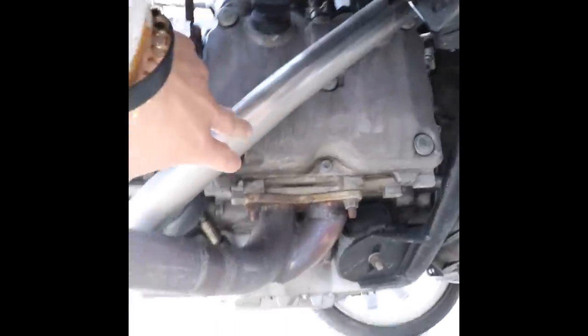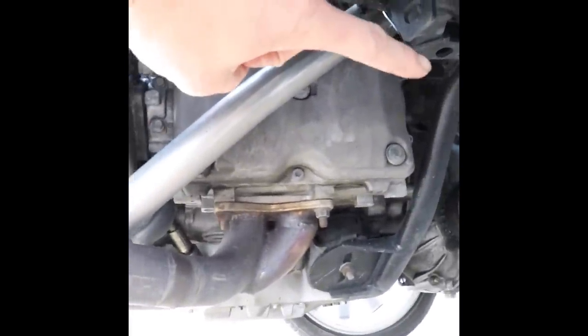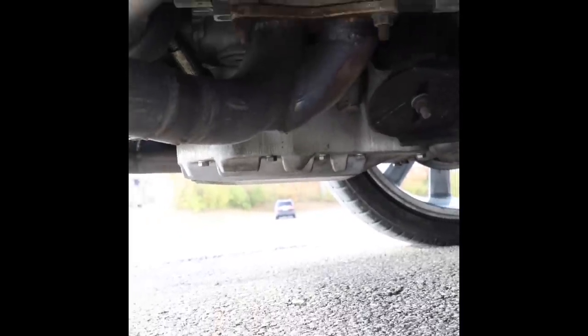It also comes with the coolant stuff — that's a coolant pipe running from the water pump, and it runs up here right to the hoses that go up to the radiator on the stock Volkswagen, so that's all complete. The engine fits really good under here. There are also a bunch of different oil pans you can get. I did get the Small Car oil pan, which is all aluminum and has pretty good ground clearance — at least what factory is. It's super strong cast aluminum, it's real thick, super beefy, and it doesn't leak whatsoever. That's something you can decide on yourself because there's a lot of different companies that make oil pans for the Vanagon Subaru conversions. I opted for the Small Car one, and so far it's been a very good choice.